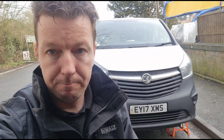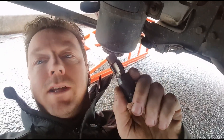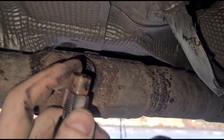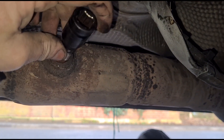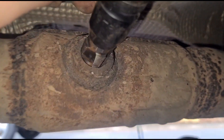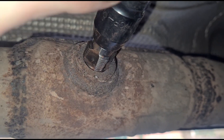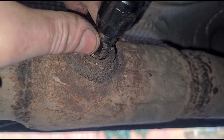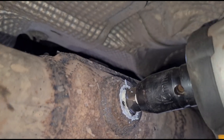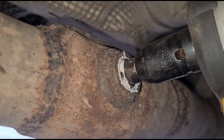I'm going to have to use this tool from Pickler Tools — it's a NOX and particle sensor service kit, part number 60525200. These are basically used to drill out the hole, cut it out, and then put an insert in. In this case, I'm going to try to re-tap the hole first. We're back under the van with the tool ready. This piece on the end ensures that when you get it in the hole, the thread is evenly leveled up — so it goes in straight, not on an angle. I've greased up the thread tool and wound it in and out a few times with an electric gun.